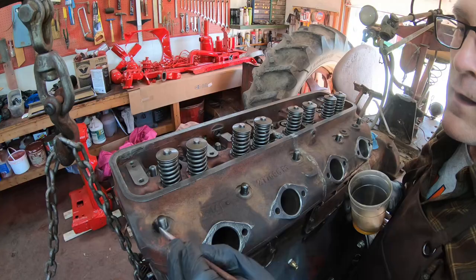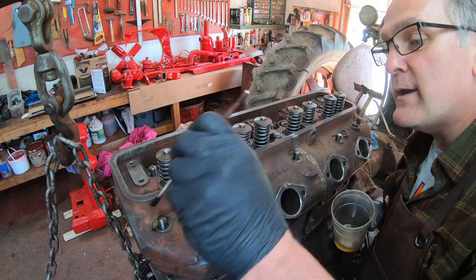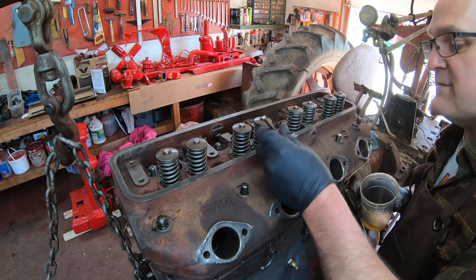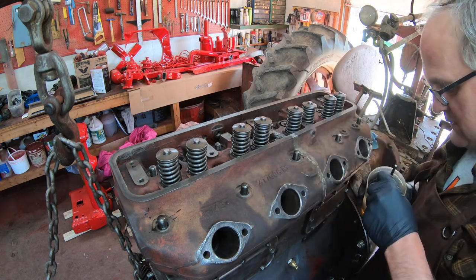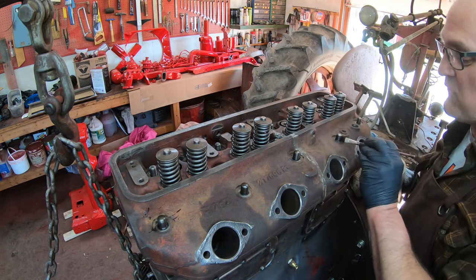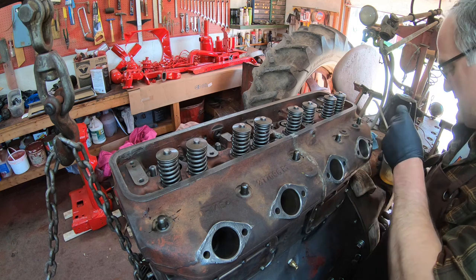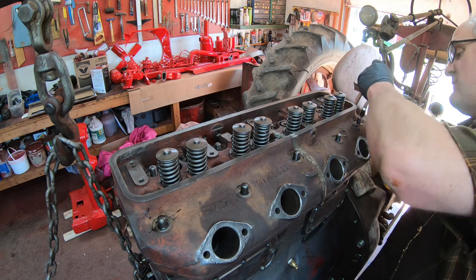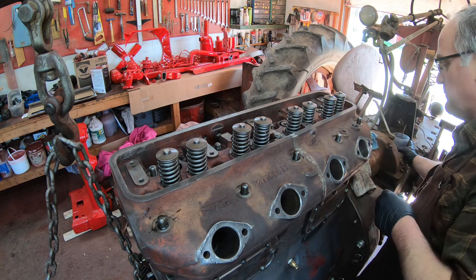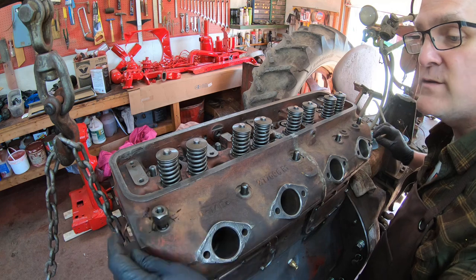Just kidding. I prefer to lightly oil these threads to ensure that the head nuts go on smoothly and torque properly. Although there is a difference between lube torque and dry torque, on this old engine, torque ranges are usually given in about a 30 foot-pounds range, and a lot of the old timers didn't even have a torque wrench, so oiling, not oiling, really doesn't make a big difference. I just like to know that they're all going on with the same kind of smoothness.